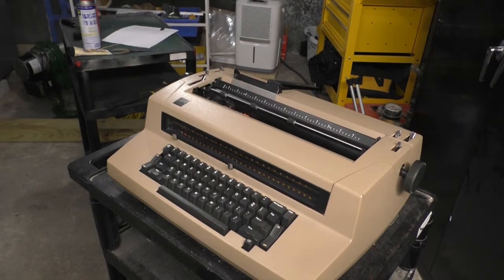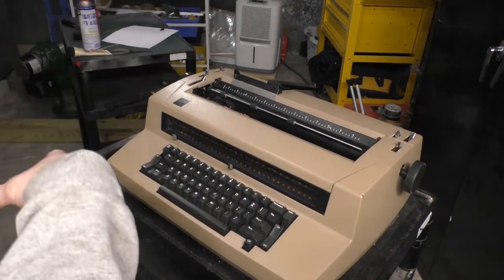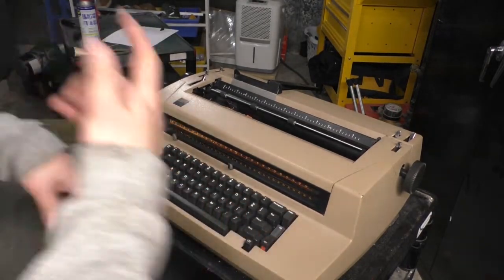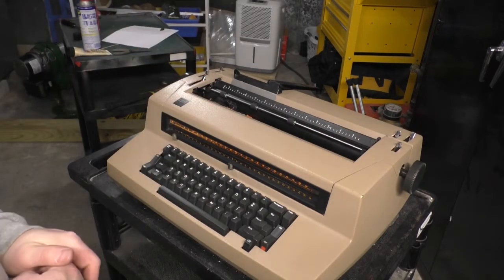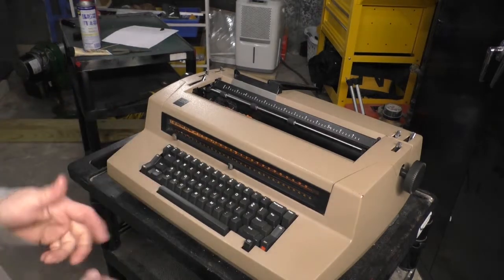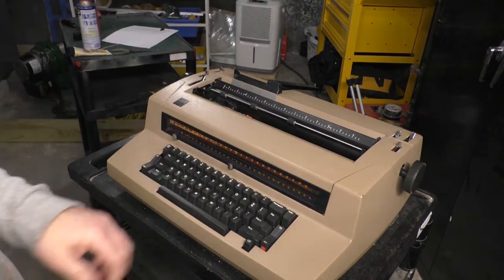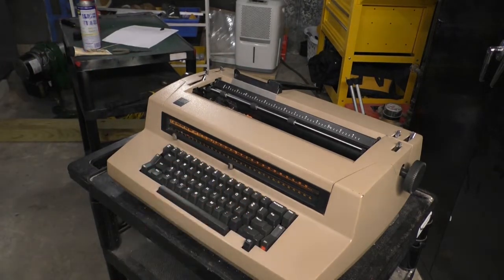But there are plenty of folks who service these correctly with new belts and parts that have broken. If you turn one of these things on and it goes clunk, clunk, clunk, it's that nylon pulley inside, which is an act of Congress to replace, but it's doable. You can still buy the part. If the motor spins and nothing happens, there's a possibility that the belt is broken. This one is actually about five minutes away from having a broken belt.